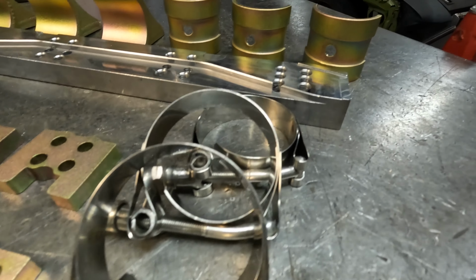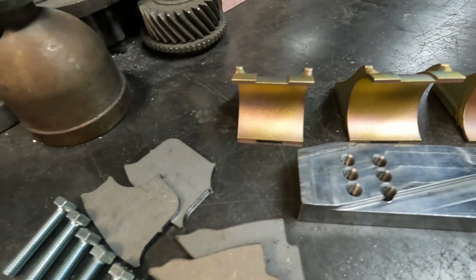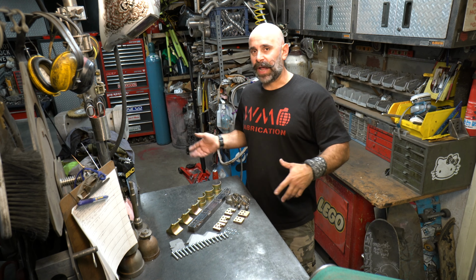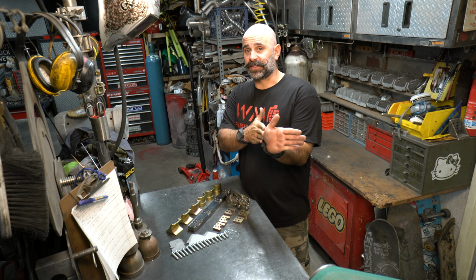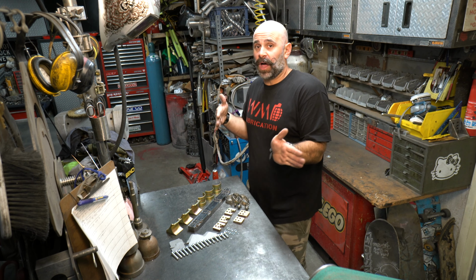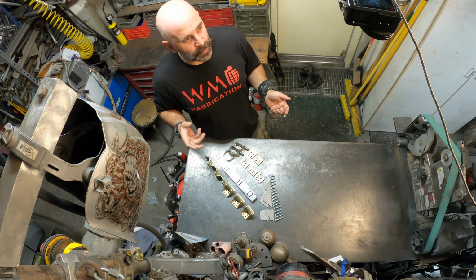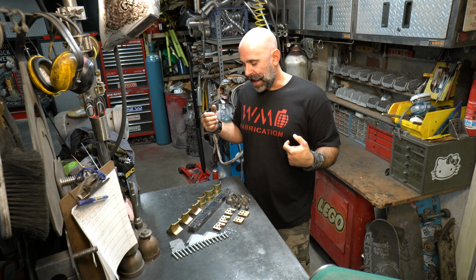And something a lot of people don't realize is that when you're drifting, there's something called rack over-centering, or when your tie rod's over-center. And that's a terrifying thing when it happens when you're drifting. Because essentially that tie rod, which is pushing out, it locks. So it doesn't want to come back. And so you go to full lock when you're drifting and your wheel doesn't re-correct. So this is a terrifying moment. You have to muscle it back to get your wheels to track again.